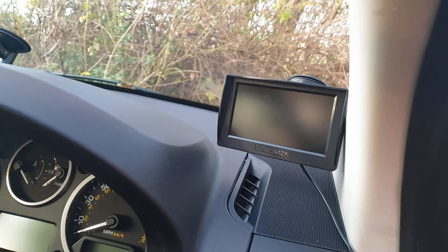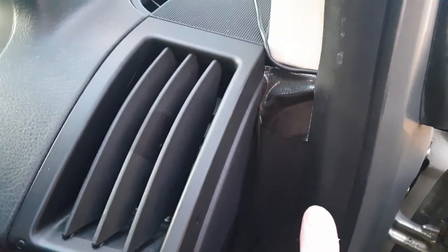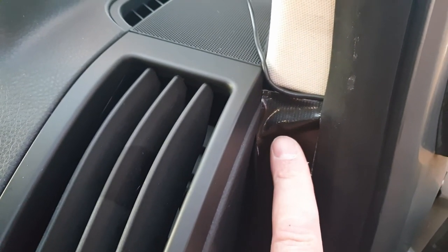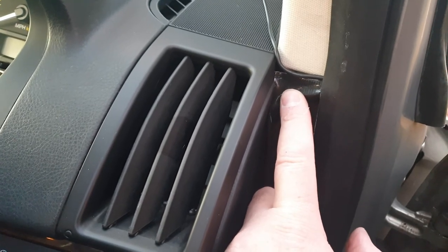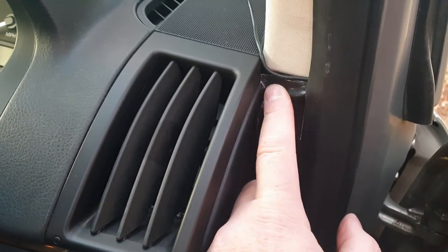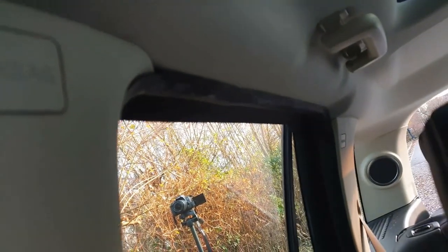There's the screen using the screen mount. Wire coming out — and as you can see there's a piece of tape from when I fitted the dash cam, as you may remember if you're familiar with our channel. I've just gone into the same bit of rubber as I did with the dash cam, all behind that trim all the way around, and then on the inside I tucked it behind the airbag and followed the rubber trim again.